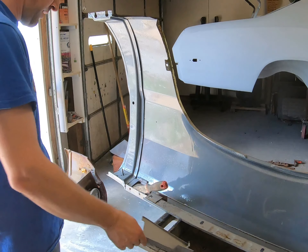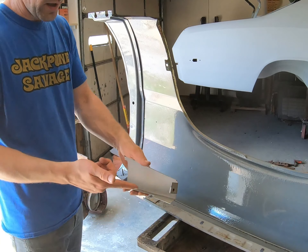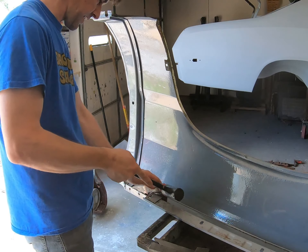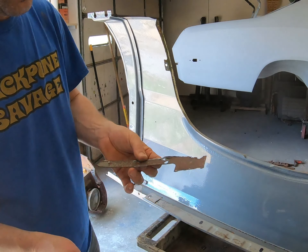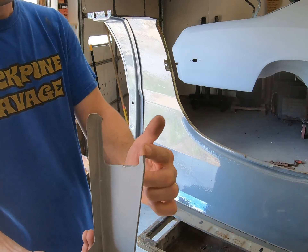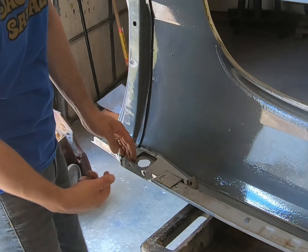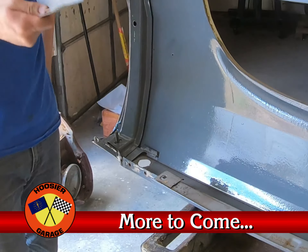We're all blasted up, looking pretty good. We drilled through the spot welds on the old part and cut down the side. I like to use a cutting knife when you get things weakened out. Here's what you've got — that's the equivalent of that. This has been trimmed where it needs to be so we can weld it up, and since we have the holes where we drilled out the old piece, we can clamp it and plug weld it back in. We'll be as good as new on that part.